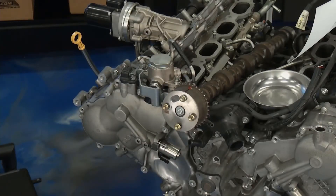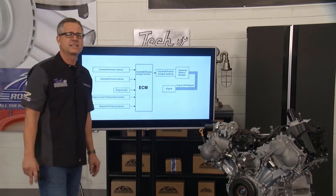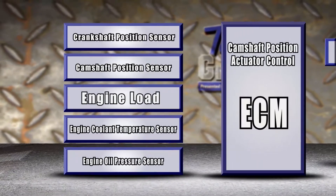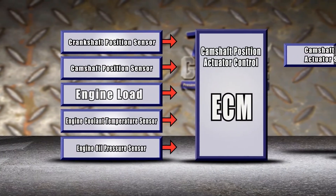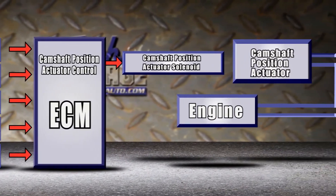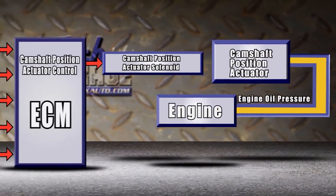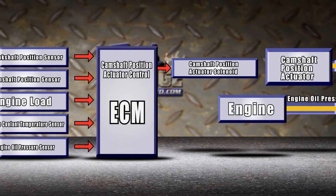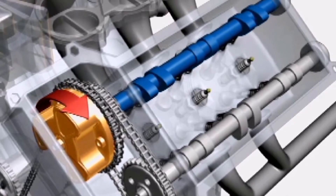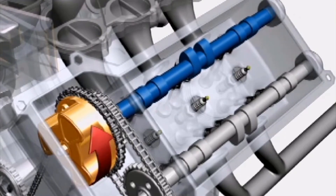Variable valve timing — what is it, how does it actually work? Well, it actually optimizes performance by moving the camshaft, and it affects timing. You have a computer on your car, and it looks at inputs — all these different sensors: camshaft, crankshaft, engine load. These are called enable criteria. When it hits certain given points, it allows oil to flow through the cam position actuator solenoid. Once it flows through, it's going to move that actual phasor. Here's an actual graphic and illustration of it working. You can see the camshaft is actually moving while the timing chain is not — so that allows the valves to open at different times.